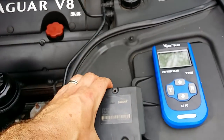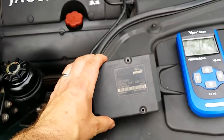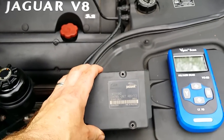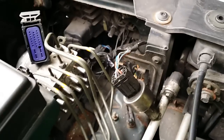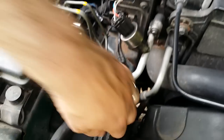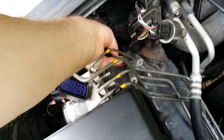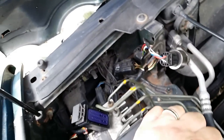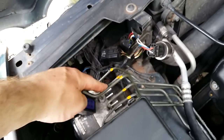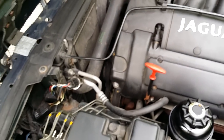All that remains to do now is for me to run some silicone around it to make sure there's no moisture ingress. I've been driving on this just with some tape around it for a couple of weeks and it's been absolutely fine, so I'm convinced the ABS is fixed. I'm going to silicone this up with a bead of silicone around it, and when that's dry refit it back onto the ABS module block. It's a bit tricky — you have to unclip the brake pipes and pull them away very carefully without too much strain. You can just work that box in. Helps if you undo these earth terminals here from the body, gives you a bit more space. You can do this job without actually interfering with the hydraulics at all, which is much easier.